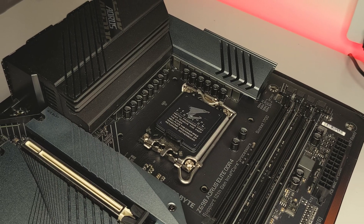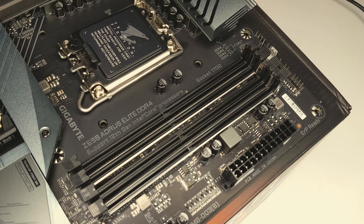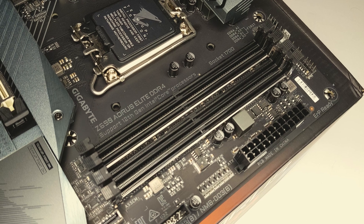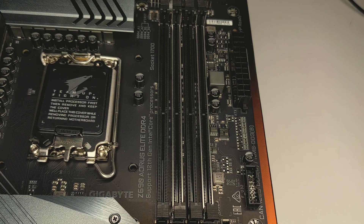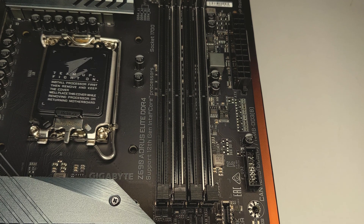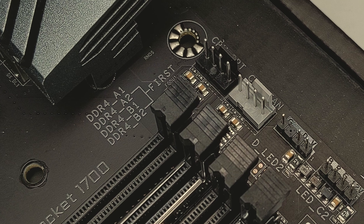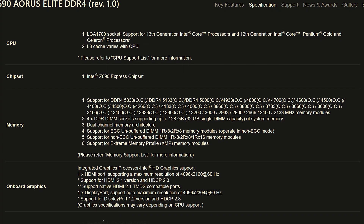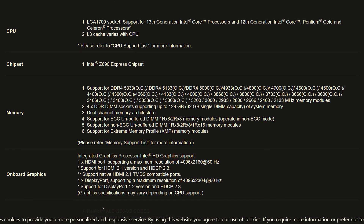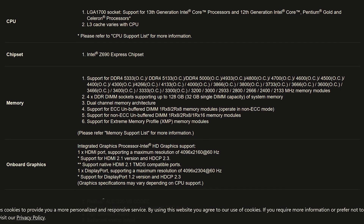This should be more than sufficient for most 12th and 13th gen Intel CPUs. Moving on, here we have our DDR4 DIMM slots and in case you weren't sure, you cannot use DDR4 and DDR5 interchangeably on this exact motherboard despite 12th and 13th gen supporting DDR5. If you have DDR5 memory, you will need to use the DDR5 version of this board. But either way, there are 4 DIMM slots in total. By JEDEC standards, this motherboard supports up to 3200 speed DDR4 but you can potentially run up to 5333 speed, though this is not guaranteed and will vary greatly depending on your CPU.